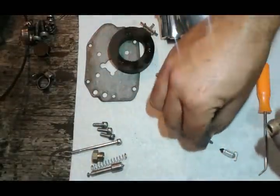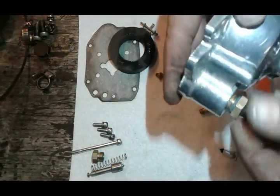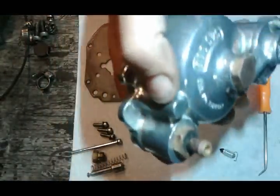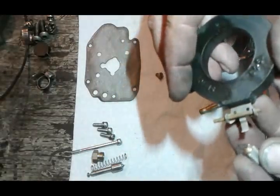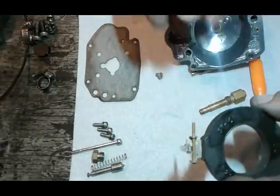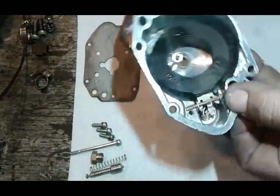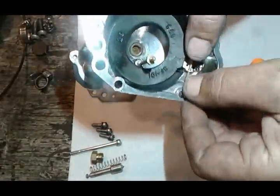Next, I'm going to put my O-ring back on here, and use the five-eighths wrench to tighten it — I'll double-check it's tight enough once it's back on the bike. Next, I'm going to put the float needle on like this, hang it on like that, and put it right down. Make sure your pin is seated in the groove, then put in the screw to secure it.